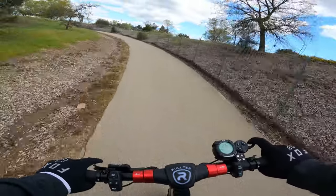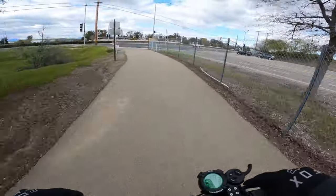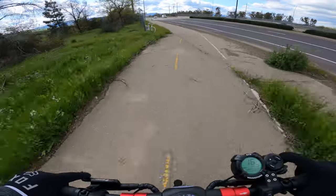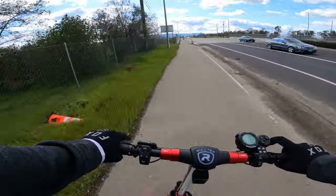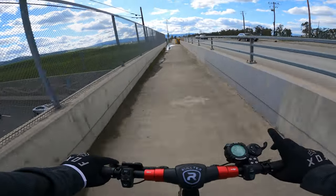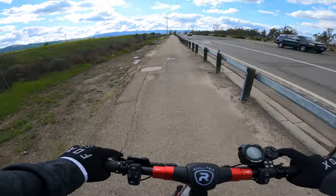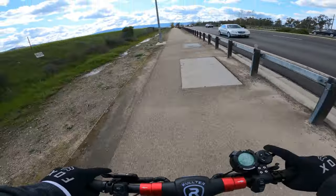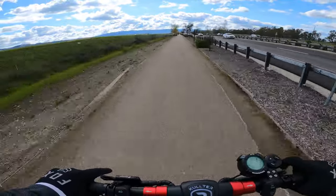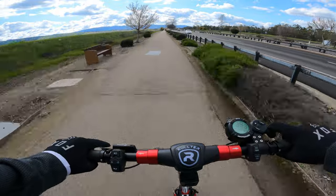Even if it does a little under 30 miles, you could still pretty confidently squeeze out 40 or more just by reducing your speed a bit. I think the number is something like you get 5% of range back for every mile an hour slower you ride. On this test, my average speed is probably gonna be somewhere between 25 and 30, maybe closer to 25, because I'm not going full speed the whole time.